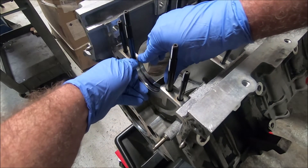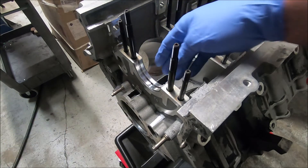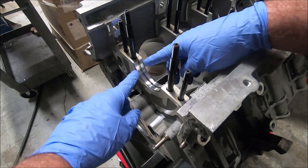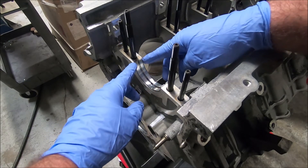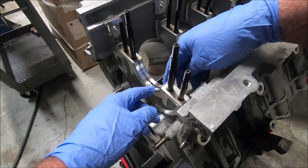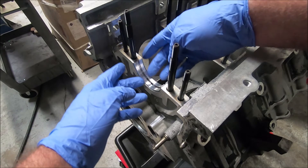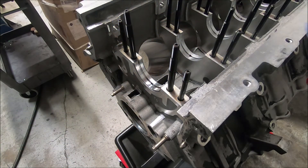The bearings are going to protrude a little bit over the top on both sides — that's part of how the bearing crushes when it gets tightened down. I also keep an eye on the lip on the sides. The bearing isn't quite as wide as the surface of the block, so I try to make sure there's an equal amount of area on either side.